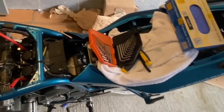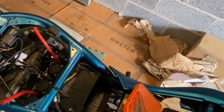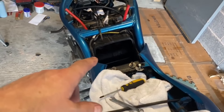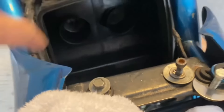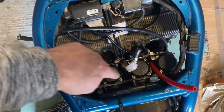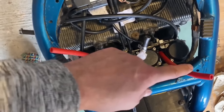Let me tighten everything up and get that airbox back on — that'll take ages. The airbox took a long time to get on. You have to match these ducts up with the ones inside, and they're not just a case of butting up against each other — they lay over each other and you've got to get the jubilee clip on. As you're pushing one end on it pops off the other, so you have to wiggle them on slowly. I fasten the middle ones up first because they're the most difficult, then the end ones slip on a bit easier.